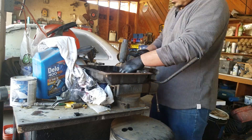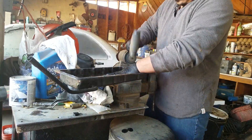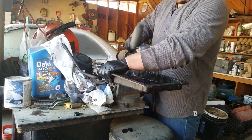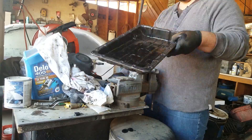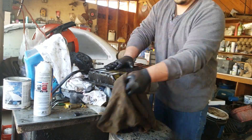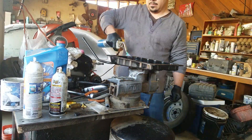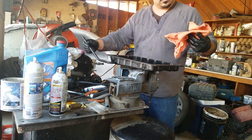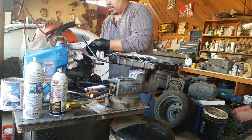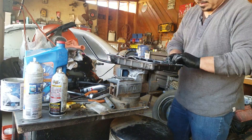The next thing I did was basically just polish it up to get all the grime off — I don't want a dirty pan under there, especially after installing a nice new exhaust. I use a torch to burn off all the moisture and oils that will be touching the gasket, so it has a clean surface to seal onto. The gasket has slightly smaller holes so the bolts hold themselves in, and I tighten them down to around 18 foot-pounds. It's not much more than a spark plug, so be very careful not to over-tighten or you'll blow out the hole.